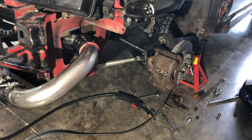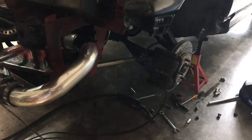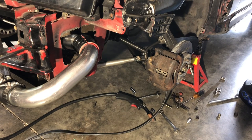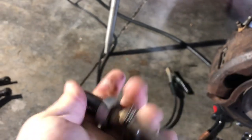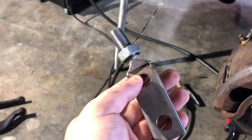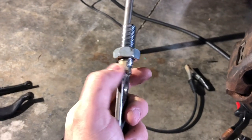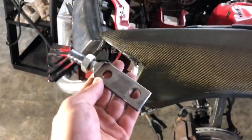Tacked on the back and the front. Turning off the welder, I'll unbolt it and show you off the car, then weld it much better off the car. Here's the part that's tack welded — one small tack on each side. It looks dirty, so I'm going to clean it up with the wire wheel to make sure it's nice and clean before doing the full weld all around. I'll do one side, then the other side, then the corners, melted in — the other side came out pretty good.